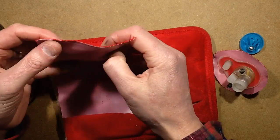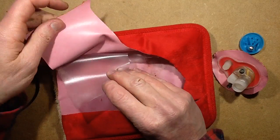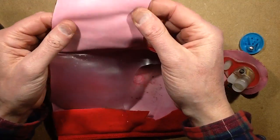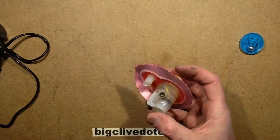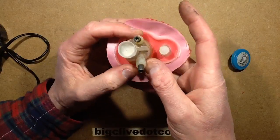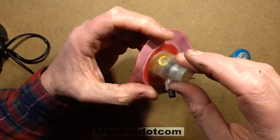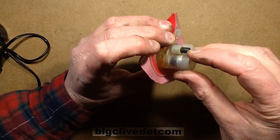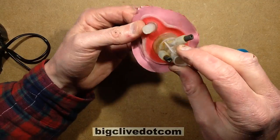Now it's open, it reveals a sort of vinyl-y inside — a clear layer and then a rubbery layer beyond that, so a couple of layers of protection, the outer one having the fleece layer stuck into it. The heating module itself consists of a cap that snaps off — this bit's glued in — but inside are two carbon electrodes and a bimetallic thermostat, just physically pressed into a sort of flexible rubbery plastic.